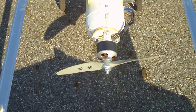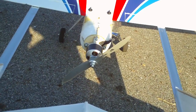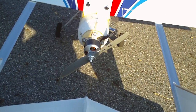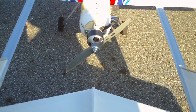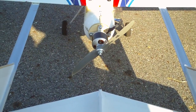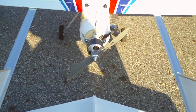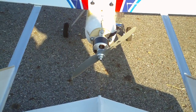You can see I have my stamp of approval balance on the prop. The 11x8 works really nice — probably a 12x8 would even do very nicely. Right now I'm running at just under half throttle and I'm getting 20 minutes on 4000 milliamps. The system runs slightly warm to the touch, but not hot at all.